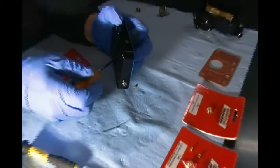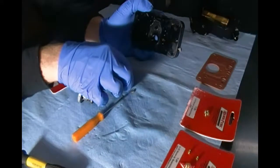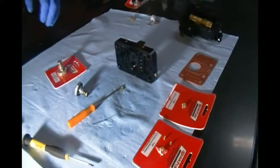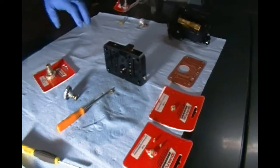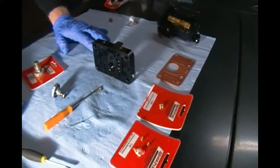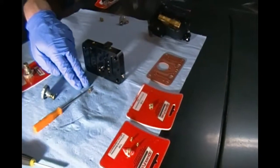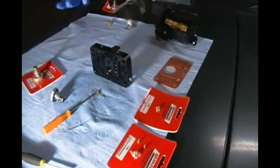It's really hard to video a black carb with all the shadows. So you take a very little flat blade screwdriver - get a good screwdriver with a nice flat surface. A steel screwdriver for tuning chainsaws works really well. You just put these in super light and unscrew them. We're not actually going to swap them here because it's already been done... actually I am going to swap them. Because when I drove this before I'd like a little more fuel added. So you tested it and it was a lot better, but this is now fine tuning. Going from 45 to 49 - just a little bit bigger, just to get a little bit extra fuel.